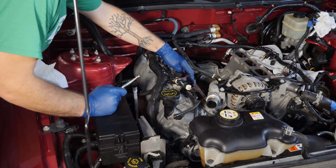It looks like we're fully loose. Now we have to get creative about pulling this off — we have the VCT solenoid to pull it off of, plus a huge electrical wire to deal with. There's a small ground wire making everything a little too tight, so I'm actually going to remove that — it's just a 15 millimeter bolt. That frees up some wiggle room. I also flipped the harness over the top of the oil filler neck, and now we should have no issue pulling the cover off. Set it aside.